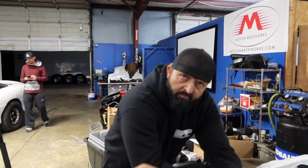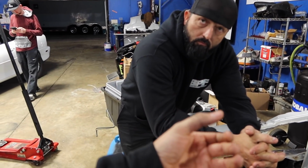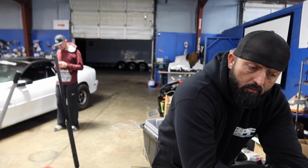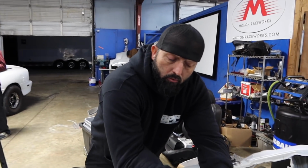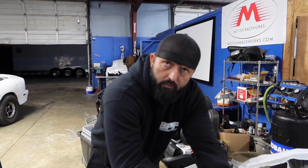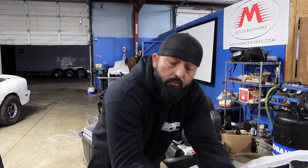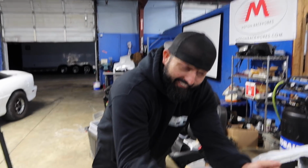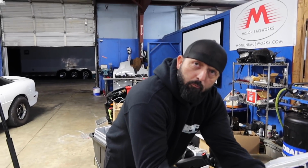So let me ask you, the end piece, do I crimp the ends of the actual primaries? How do you get them to slide over? What we'll do is go to a piece that's, you know, 2 1/8, whatever slides right over the 2-inch, and we'll TIG that onto the end of your zoomies. Excuse me. And then that'll slide right in, and we'll put your tabs on them.